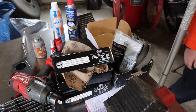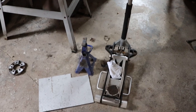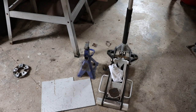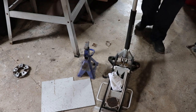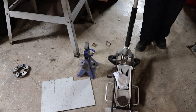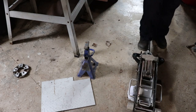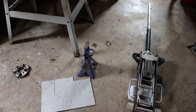That's almost it for the introduction. You'll need a three-ton jack for this job — you could use a smaller one, but you'd be working it pretty hard. I'd recommend a jack stand as well; it'd be better to have two when doing the back so you can have both wheels off at the same time and use one side as a reference to the other. If not, take pictures of each side.